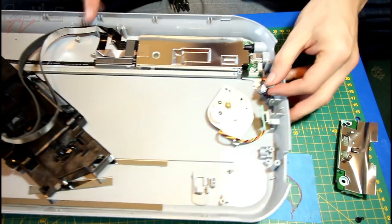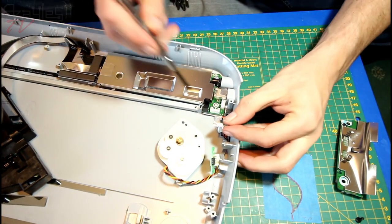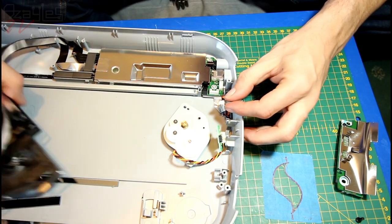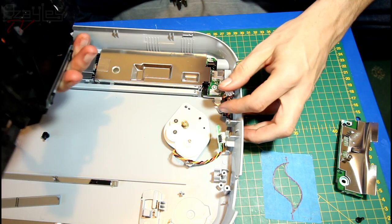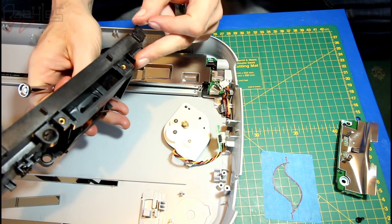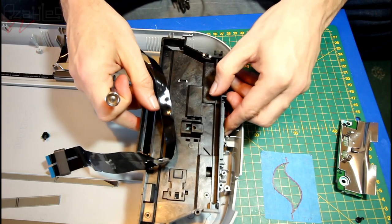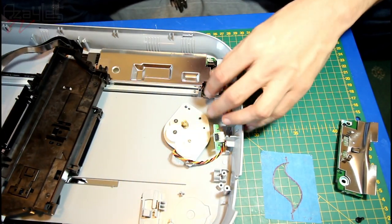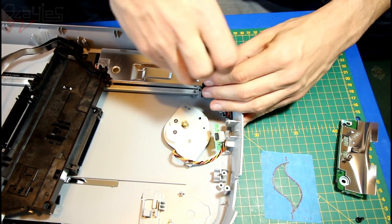Well, this is fun. Down on this end, you've got a slotted optical sensor. It's just there. So when this moves back this way, something engages with this. That little tab there cuts the beam of light and it works out that that's now in the precise position it needs to be to start, and it can carry on from that. So it's like a zero sensor, which is handy.